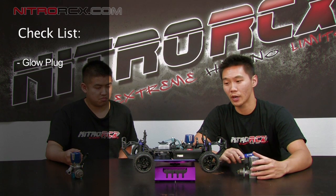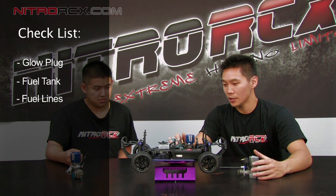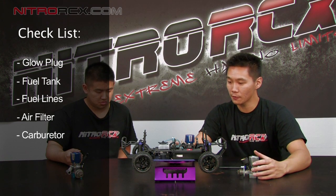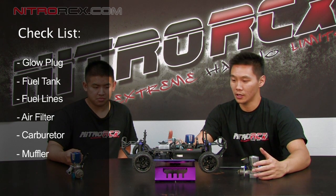The first and most basic question we get is: what do I do if my car won't start? Nitro engines are two-stroke engines and they run on nitro fuel, air, and spark — which is your glow plug. Without these three elements it's not going to run. So the first thing to check is your glow plug — pull it out and make sure it's glowing nice and bright with all the coils intact. Then check your fuel tank to make sure it's holding pressure with no leaks, check your fuel lines for air bubbles, check your air filter to make sure it's clean, check your carburetor for dirt or restricted airflow, and check your muffler to make sure nothing is blocking it. Start tuning from there.